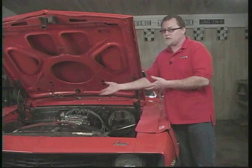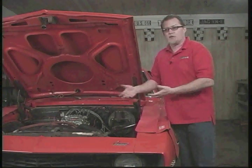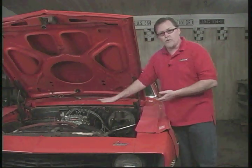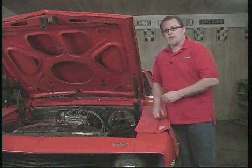So even though everything's new, you could still have something in there. Another problem could be fuel pressure too low — just inadequate. Under a load, you drain the float bowls down and then there's not enough replenishment in the carburetor to keep it going. So you want to check for things like that.